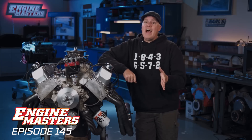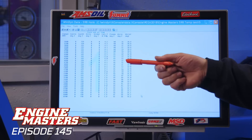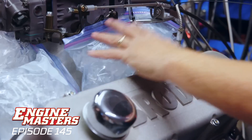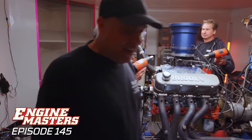This time we're going to find out how to cool the gasoline under the hood of your car. Why would you care? We found out twice on Engine Masters that hot gasoline is bad. The first time we were trying to figure out why cooler coolant temperatures make more power. We were also testing ice cubes on the intake manifold, and what we actually found out is that it was cool gasoline making the power improvement, not the icing of the intake runners.